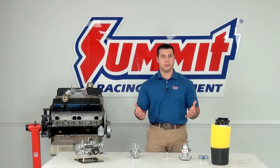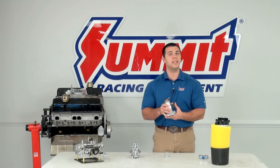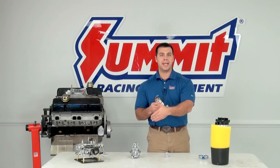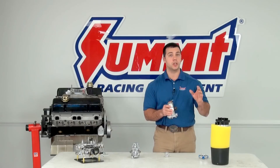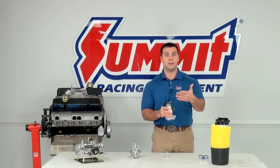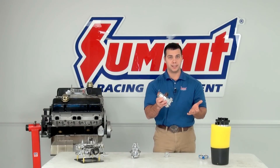What about electric fuel pumps? As I mentioned, they are pusher type fuel pumps, so you need to make sure they sit as close to your fuel source as possible. Don't mount one on the firewall — you'll end up damaging the fuel pump. These pumps also need to always have fuel going to them, so don't run your fuel cell completely dry after a run or while driving. The fuel inside your tank actually cools as well as lubricates these fuel pumps.